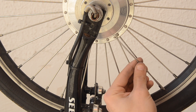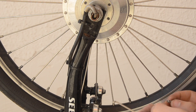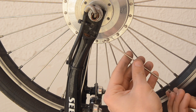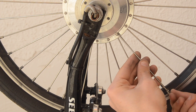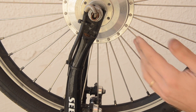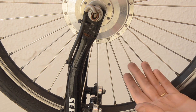This truing process will make more sense if we know how these spokes work. A spoke is basically a long bolt, and then you've got this special nut called a nipple that goes on the other end. The spoke just screws right into the nipple, just like a bolt screws into a nut. The spoke actually pulls on the rim and creates tension through the spoke. In this case, these spokes are laced radially, which means they go straight out to the rim. What would be better is to actually have cross-lacing, where the spokes cross each other.